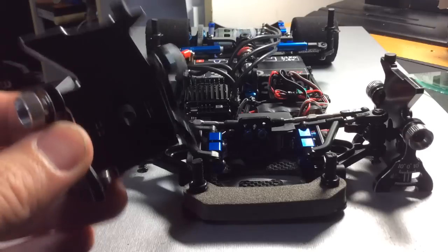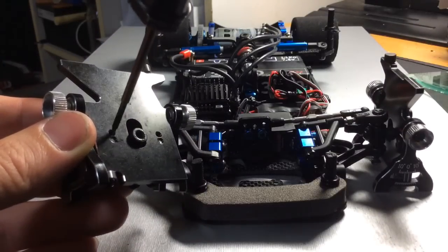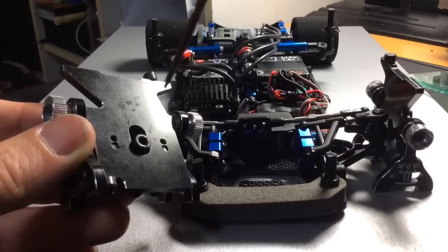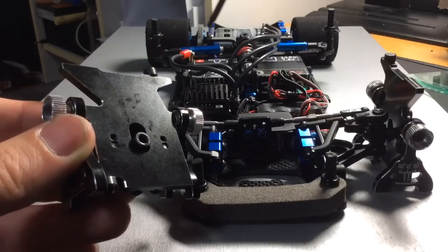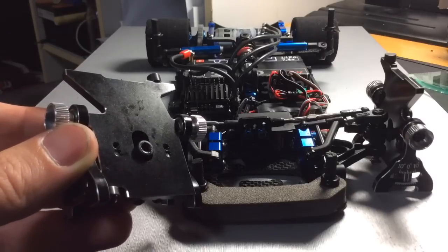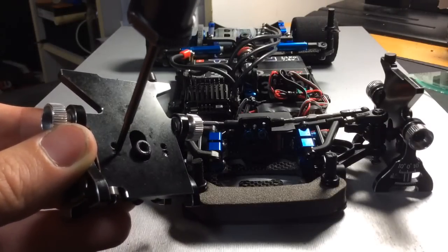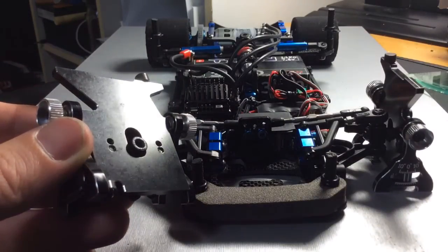And then you want to turn to the back. On the back here you have, there we go, screw holes. You have upper screw holes and lower screw holes. The upper screw holes are meant for the Plasma LM. That is the Le Mans series. You do not want to use those if you are running a competition style 1/12 scale like the Plasma RA, Team Associated, Speed Merchant, Top Racing, you name it. The competition 1/12 scale holes are right here when you bolt on your plastic insert. Okay, so just remember that.